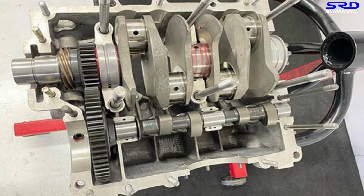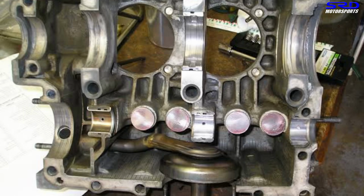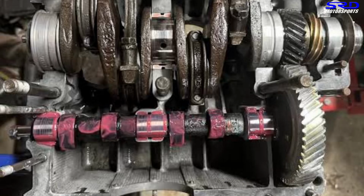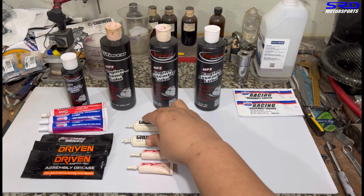I've learned the importance of it in building VW engines. I've built a few. I've never had flat cam lifters, and you can see here the camshaft at the bottom of the crank. The lifters, you gotta lube that well and break it in properly with a cam. The cam break-in is crucial in VW, or else you'll get your cam and lifters flat. See this assembly lube? So of course, when I build the engines in the Honda, it transferred there, even to all the other brands.